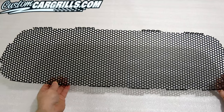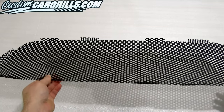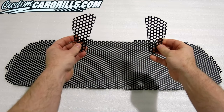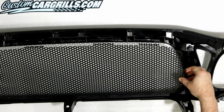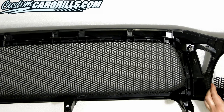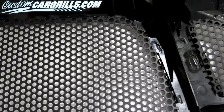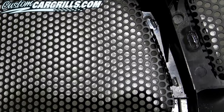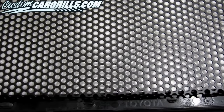The cut edge was then sanded and we sprayed it with some flat black that'll better fit this mesh look. Now, on to the mesh. Here is our pre-cut and pre-bent piece that is made just for this application. The mesh style I'm using here is our small perf mesh that is a quarter inch holes, but this is also available in our slotted mesh. A test fit of this piece shows we did a good job on the cutting portion of this mod. If there's areas preventing the mesh from going in, then additional cutting may be required. Here's a close-up of the mesh on the back of the opening — there should be a thin margin of mesh all the way around. The bent tabs are facing forward and fairly snug on the outside perimeter.